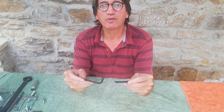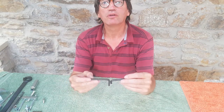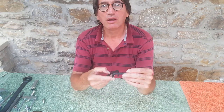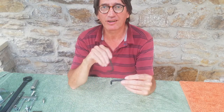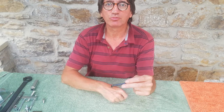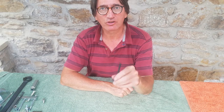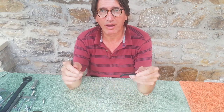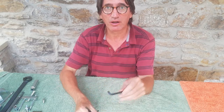Here's a special Allen key for removing the carburettors. You can see one side is normal length and the other side I've cut down. You need to get these onto the carburettors but there's no room to get the Allen key in, so you take a normal Allen key, cut it down — which is a bit of sacrilege — and then there's just enough room to get it onto the Allen keys on the carburettor flange. Removing and replacing the carbs on a Commando is a nightmare because they're parallel, not splayed like on a Bonnie, and trying to get in to do those nuts is a complete nightmare. Cut-down Allen key is the solution.